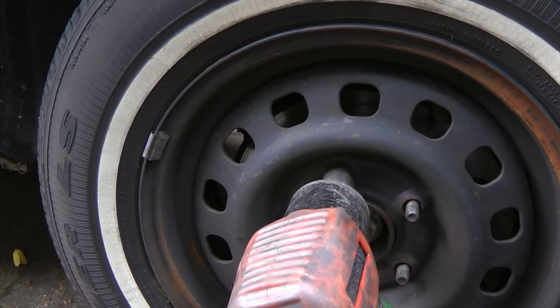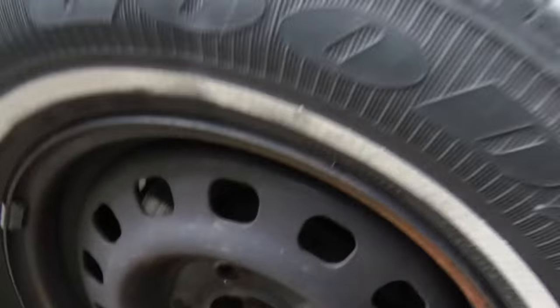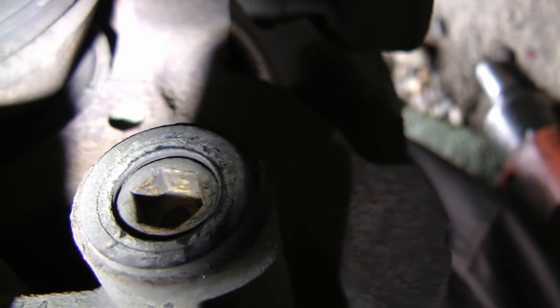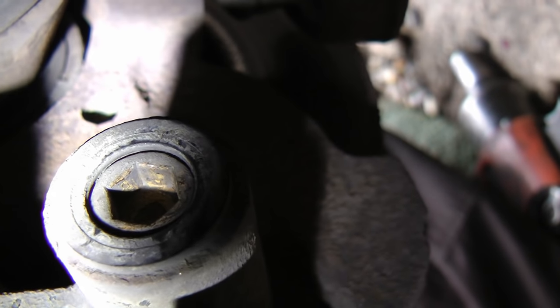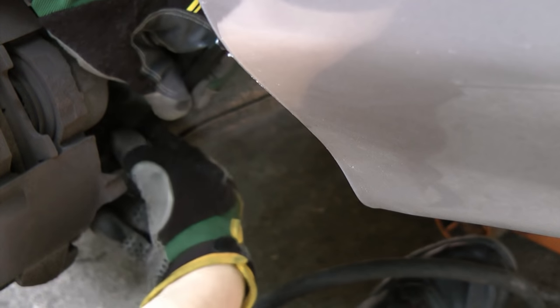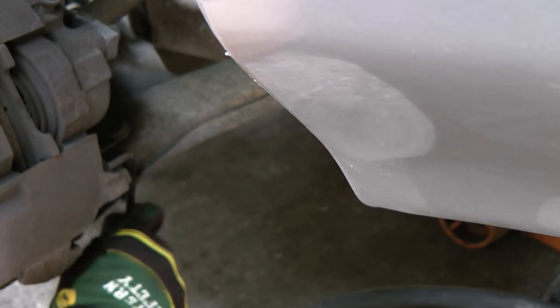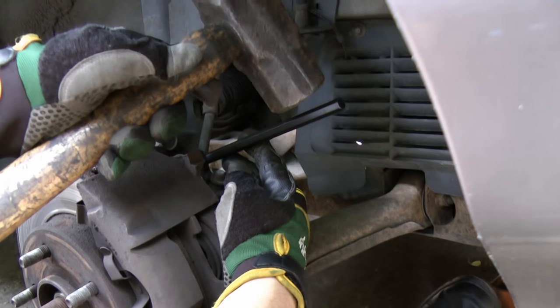Just pull off the wheel and check the brake rotors — you can see they're really worn here. Now you have to remove the brake caliper in order to get to the rotor, so you have to take the two bolts off. As you can see from this backside view, it's an Allen hex wrench — in the case of this Buick, it's a 3/8 inch Allen hex wrench. Put the wrench in, make sure it's snug, then use a hammer to loosen it — there it goes. Do the same thing on the top bolt.